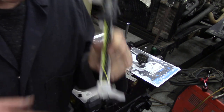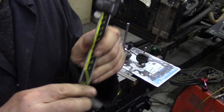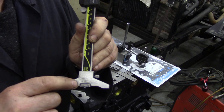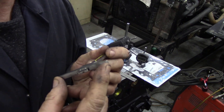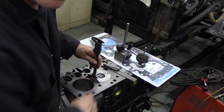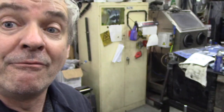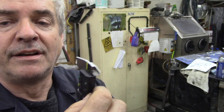A few weeks back I got one of these depth gauges for checking out the heights of valves, and it screws onto your gauge here. Everybody's got these now — they're cheap as chips, about $20. I attacked it with a grinder because the contact area wouldn't straddle the piston. I ground it down so there are just contact areas on here, and it works remarkably well because it's easy to read. You just slide this piece up and down, and you can set the tension with your little thumb screw so it's not moving around.